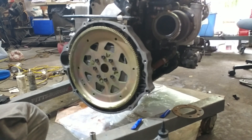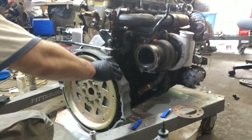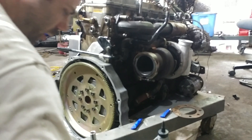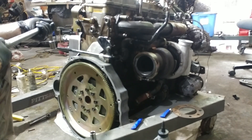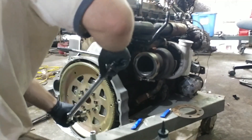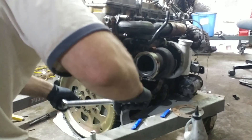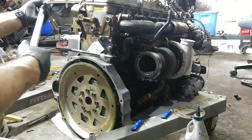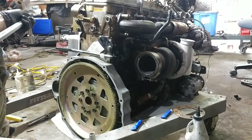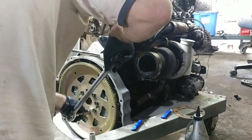I'm going to let the motor down just a little bit so that we don't have to fight it as we're torquing it — just put a little pressure on it. We're going to 105 foot-pounds and we're going to start off at 25, working the pattern. They're already at 25, so that will be quick. We like to err on the side of thorough. Next stop will be 50.